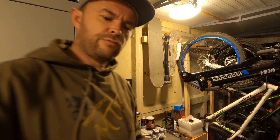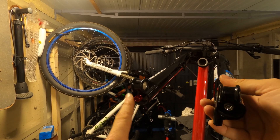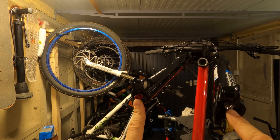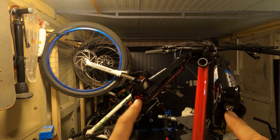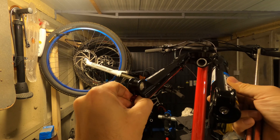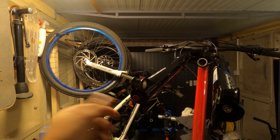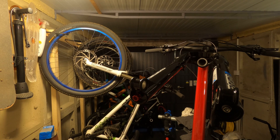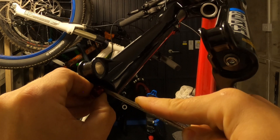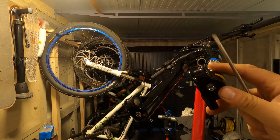In the lower section we've got two bolts — there's a five millimeter bolt here, and I believe an eight millimeter bolt underneath the rebound adjustment knob, which is the next bit we need to get out of the way. Sometimes you can just pull them out by hand, but this one is not coming by hand. I don't want to put any pliers on there and scratch it, so I'm going to use a little flat head screwdriver just to get in underneath and prize it — just twist the screwdriver. There we go, and out it pops.